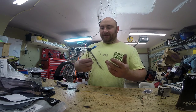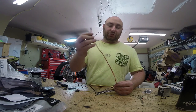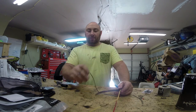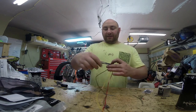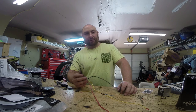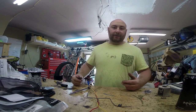These wires might look a little intimidating — like, look at all these wires, where do they go? Well, the truth is the red and the orange, which is the illumination and accessory line, goes to our ignition when we turn the key. I went ahead and put a little ring lead on there, so we're going to tie this straight to the ignition. Our yellow wire is the battery — we're going to tie that straight to the ignition where the battery comes in; it's basically always connected to the battery to make sure all your settings get saved. Our black is our ground. The rest of these wires, there's two wires per set of speakers, four sets total — two grays go together, two greens, two whites, and two purples. We're going to look at how the old one was set up and just cut and splice into that. I'm going to do my best to solder everything I can — it's always better to solder than to crimp, but sometimes you just can't get your hands in there.